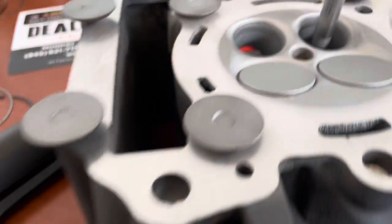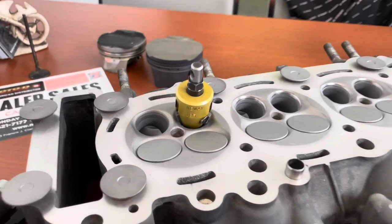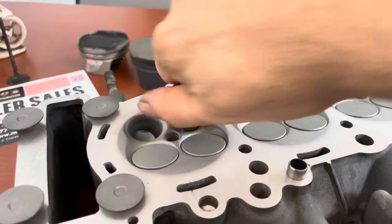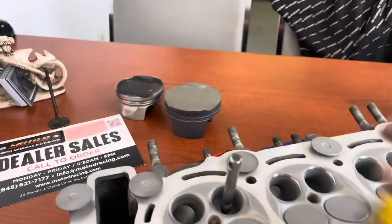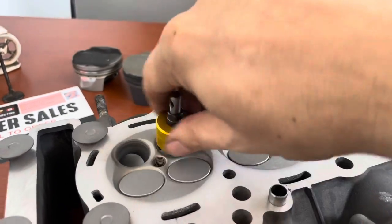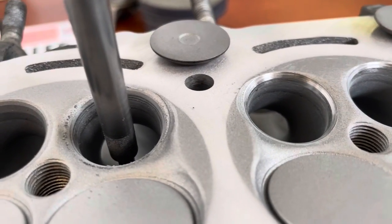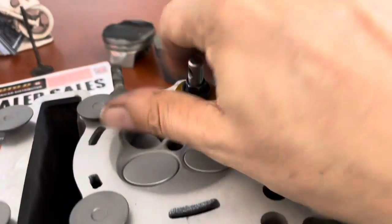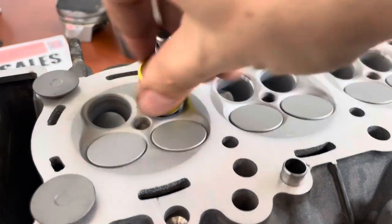Almost shiny already just from that. All we got to do is get the coating off — we're not trying to do anything more. Then we go to the 60. The 60 gets lots of grip on there. You can see that one already got some shine to it. But the 45 I will need to use some pressure on because it doesn't cut as much.